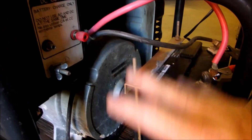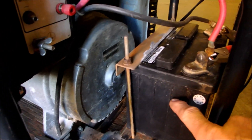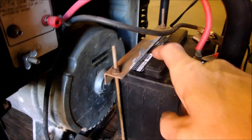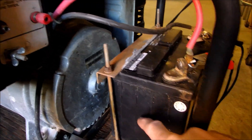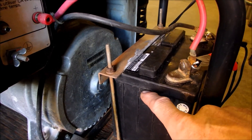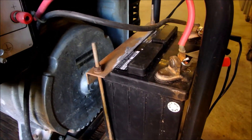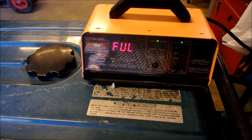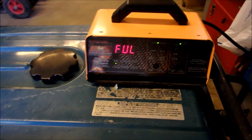So I took this all apart. I cleaned up the battery, being aware of the acid. I took the caps off and filled the battery with distilled water only — never use tap water. Then I put my little battery charger on here. It has a microprocessor in it and can sense the capacity of the battery. Overnight it's gone to full.